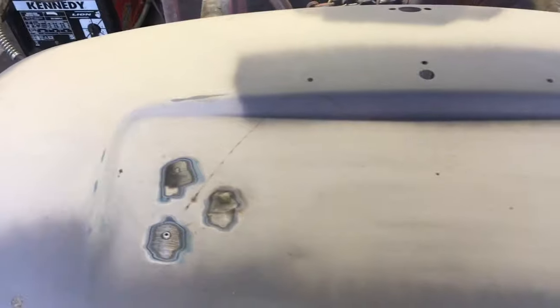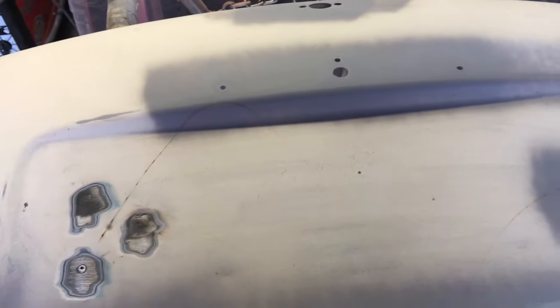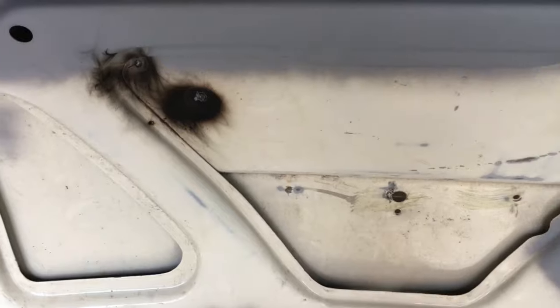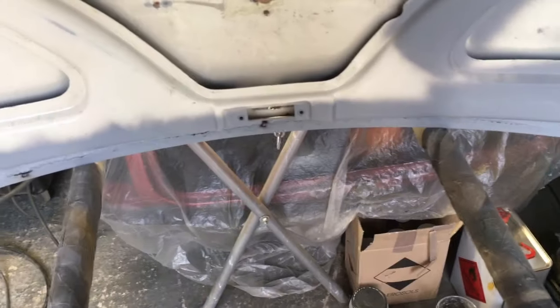You probably saw me then struggling once again with my welder, probably because it wouldn't earth out very well. I should probably have cleared a bit of paint off so it could arc out. Also, I didn't clean the paint off on the back, so that's burnt very nicely. So rookie error there, but like I say, I do try to show my errors as well.